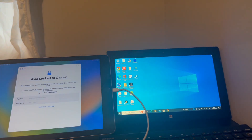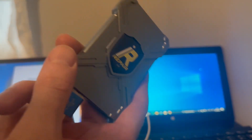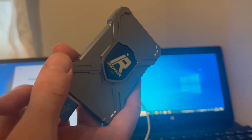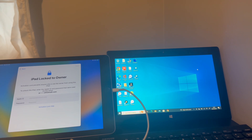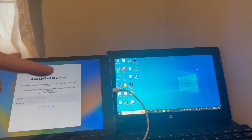I'm now going to do the removal to activate this iPad fifth generation. If your chip ID number is 8003, this method is not going to work for you. What you do need is one of these — an i-Repair P10 box, P11, P12, JCID box, B box, any type of NAND programmer — so you're able to reprogram it and then activate it.